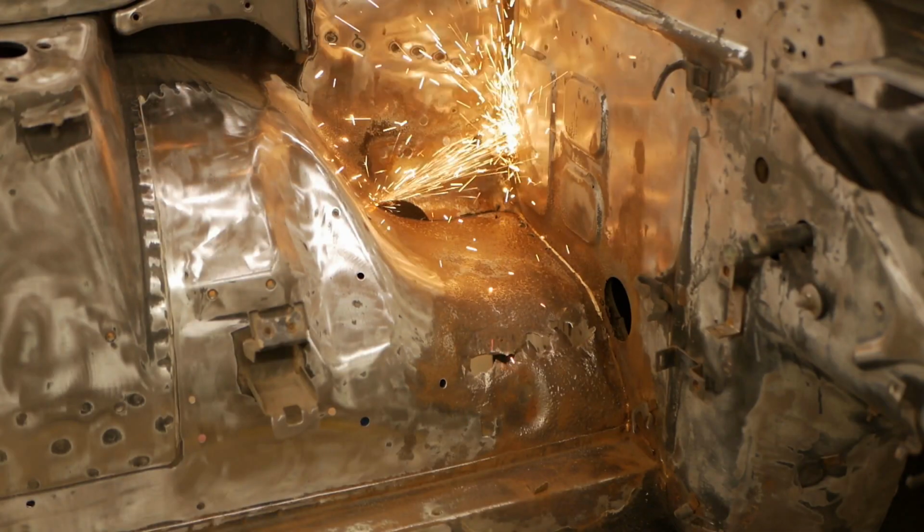Alright, so we've got the front engine bay pretty much down to bare metal. It's ready to scuff, degrease, wax and grease remove, tack cloth, and ready to throw on the epoxy primer. However, we have two problem areas that we need to address before we do all that, so we're going to go ahead and get diving into removing the rusted area of the battery tray out and then seeing how bad that firewall is.